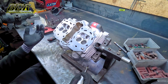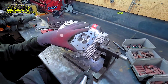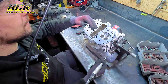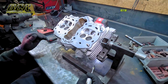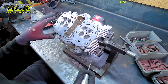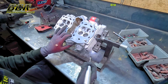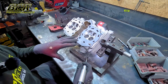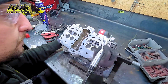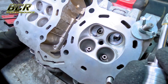The main aim of porting is to get the air and fuel in as fast as you can and out as fast as you can - the faster you do that, the more power the engine produces. With the cylinder head you can modify it to give more bottom end or more top end. At low RPM you want more velocity so you'd narrow the port; at high RPM you'd have them a little bigger because the engine's revving and pulling more in. A lot of people get tied up on horsepower figures - big numbers sell engines but torque wins races. We want torque, which is why I put epoxy resin in the intakes to straighten the fuel flow, because on these the ports have quite a curve to them.